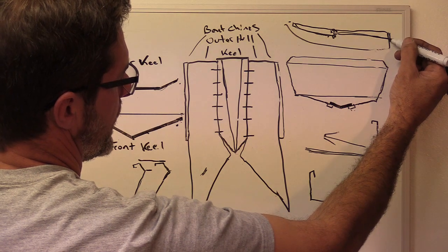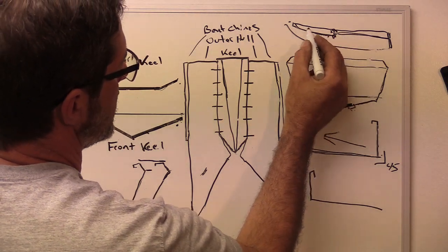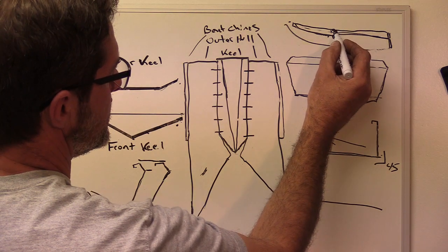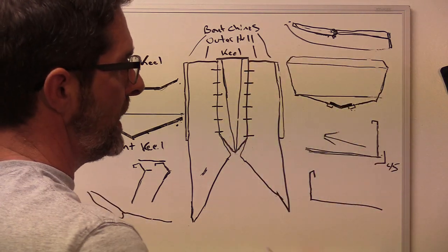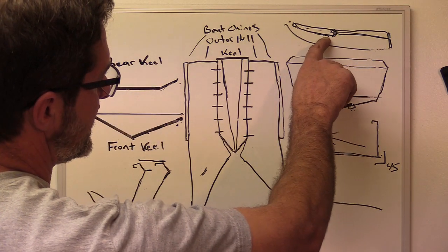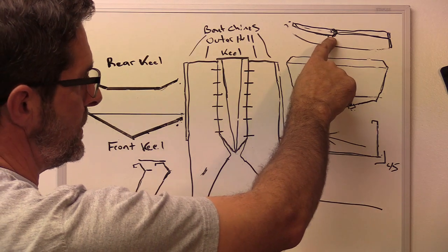Because its bend is low, I got a 1/4 inch gap at the top, tapering down, looking at it from the back. And up here, I've got this side panel hanging down off the corner where I could not match this CNC cutout and get that corner up in it. It's just because the bend is too high, you know. And that changes the geometry of trying to match this seam all the way to the front, because you're starting outside of the hole. You're not starting on the inside edge.